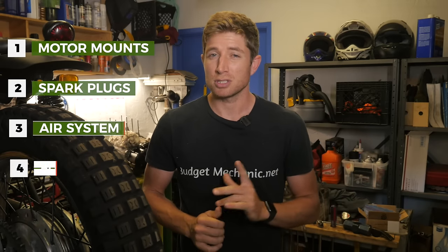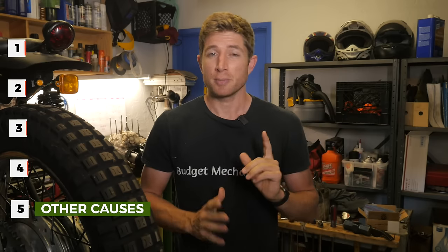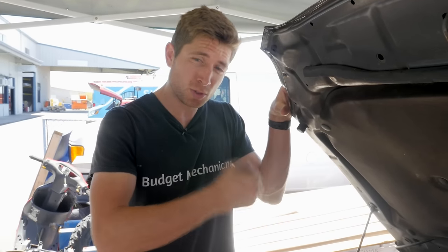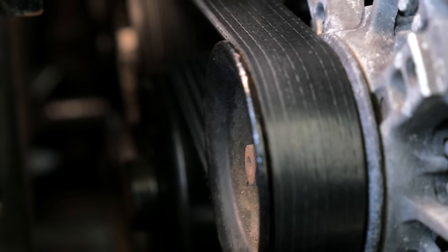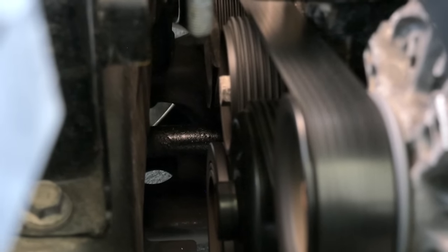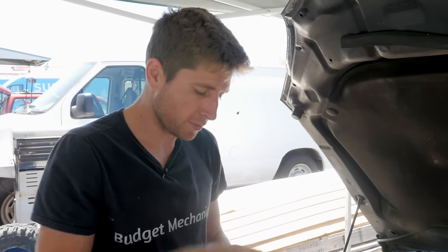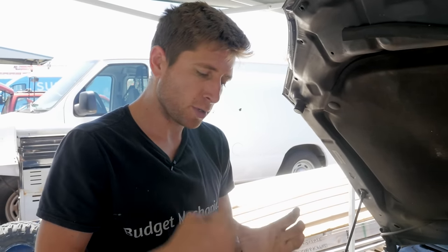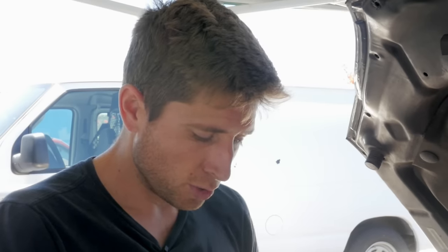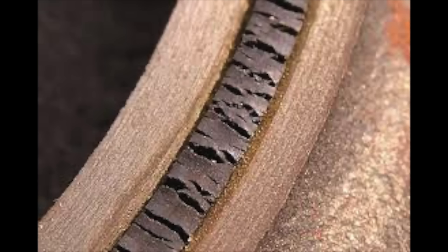If you've addressed all of these issues and you're still experiencing the same symptoms, there are a number of other causes. Another way you can get vibrations at low RPM is belts. Your timing belt and accessory belts — if they get loose or damaged, they can start flopping around. If the tensioner stops holding constant pressure and starts moving around, you'll get engine shake. You can see how this tensioner wheel right here is not jumping up and down — everything looks stable. One other possibility is your harmonic balancer or crankshaft pulley at the very bottom, which has a rubber inset or bushing built into the pulley designed to remove vibrations. You can inspect your crankshaft pulley and look for cracks, pitting, or breakdown of that rubber ring.